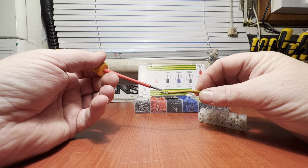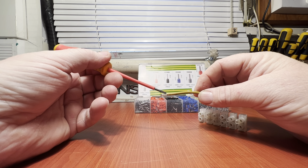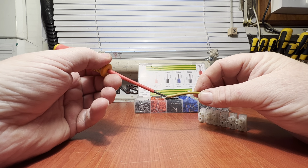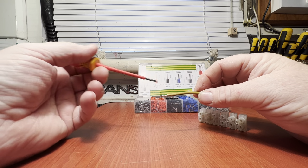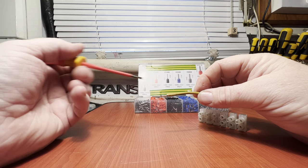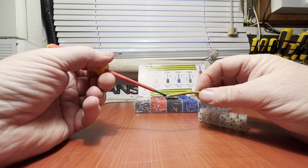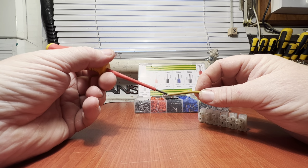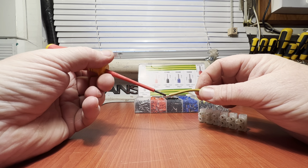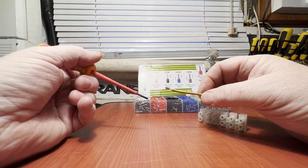The point I'm trying to make is, see if that was just the wire. If that never had the ferrule on it, that can screw into the wire and probably end up snapping some of them. So it can make it a weak joint for the power going through it, obviously. If it's not going to be the full cable that's in it, eh? So you put a ferrule on it, it gives it a stronger contact. I'm only going through what I've heard sparkies and all that saying about, but I can see for myself, if you're watching other YouTube videos, putting ferrules on does make the contact stronger, and it does a better job. So it's up to yourself.